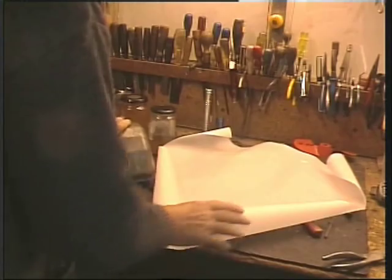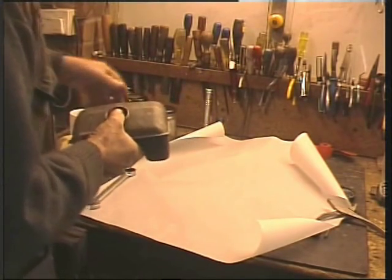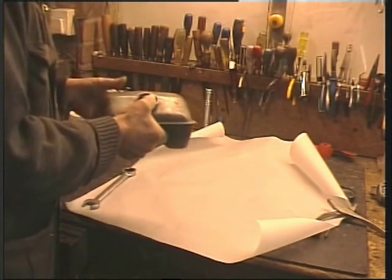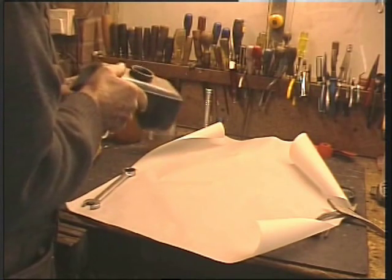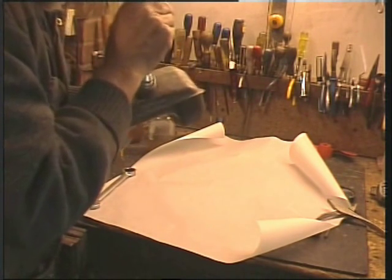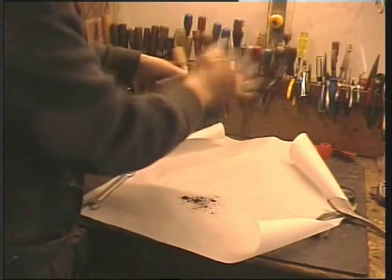The reason I'm putting this piece of paper here is because I put a wooden plug in the tank, and after seeing that and the deposit in the bottom, I've done it a few times, and I've allowed it to dry out, and it's broken down the varnish in there. Looking in with a torch inside there, I can see the varnish is sort of broken off, and that's the idea of the paper here.